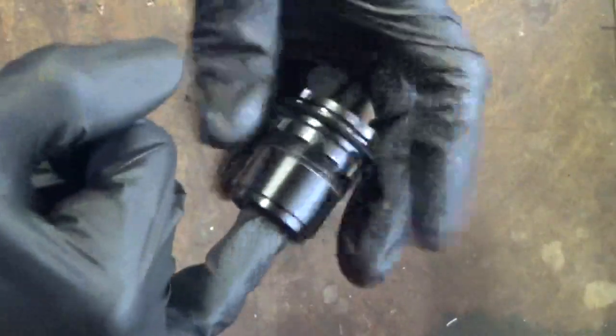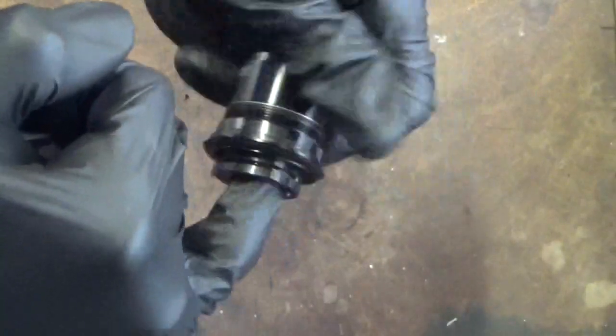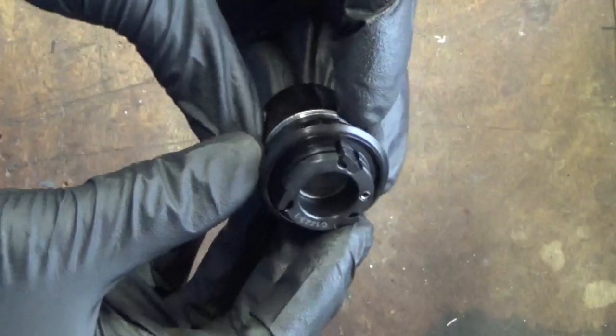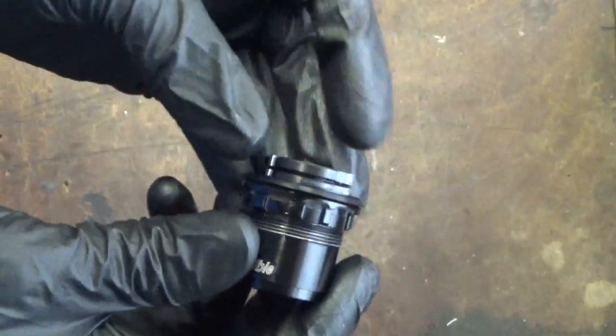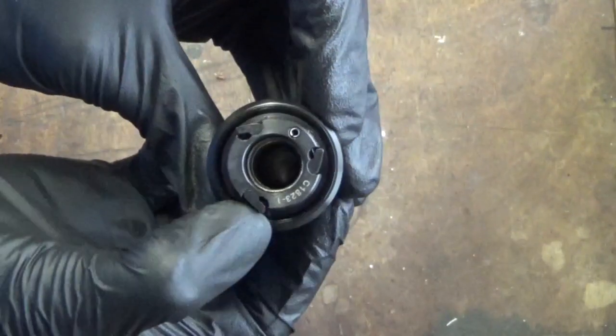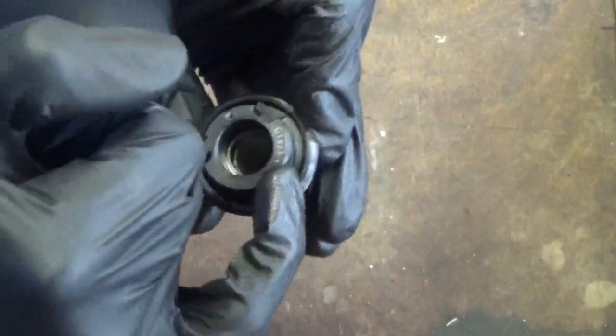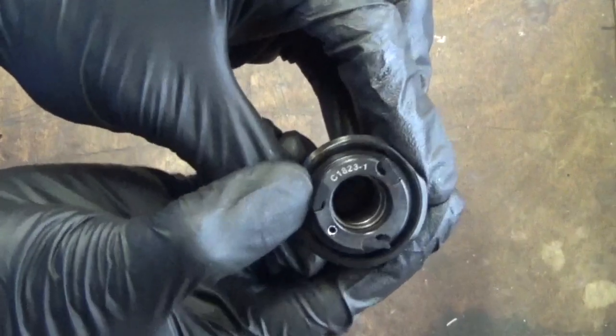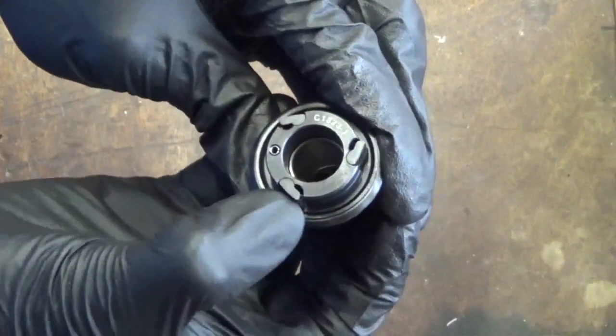Right, so once you've got the bearings in both sides there, just obviously check that it's spinning okay before you go ahead and refit it. So once you're happy with that, you can go ahead and refit this on the bike. And before you do, what you want to do is put a little bit of grease on each one of the pawls there, as this is a freehub. Just make sure that you grease those